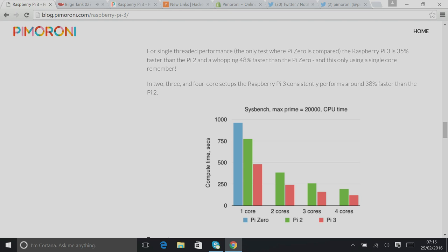Sorry, Gordon. CPU performance. What Sandy's seeing, and this is using NOOBS 1.8.0, which is the latest NOOBS build, but is not actually built for the ARM64 architecture, so it's still the same as the Pi 2's architecture. It's still the same as the B+ architecture. In fact, it's carrying that legacy at the moment. No, they updated Pi 2. They went to ARMv7. That's only the kernel that's different. All the binaries are still compiled for ARMv6 or something like that, so it's not good. But when we get a fresh build of Raspbian that specifically targets Pi 3, it should make a pretty significant difference.